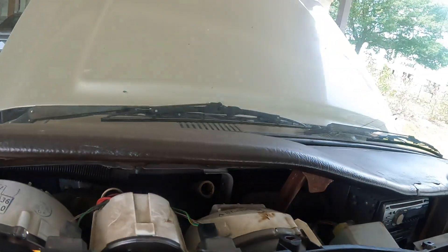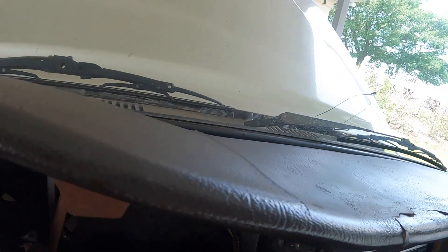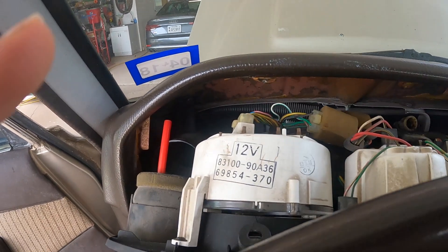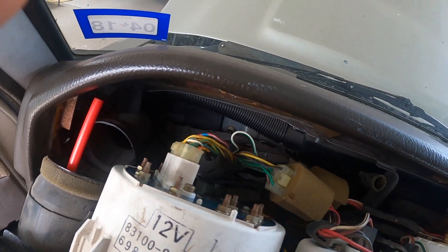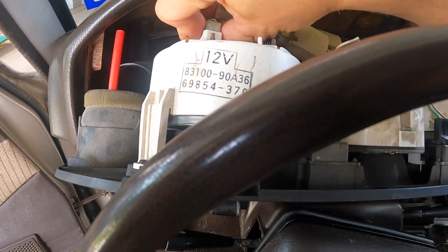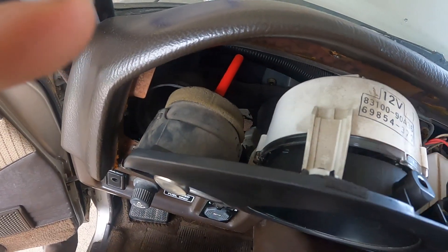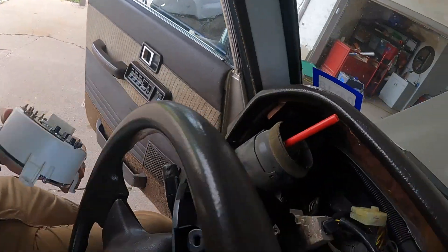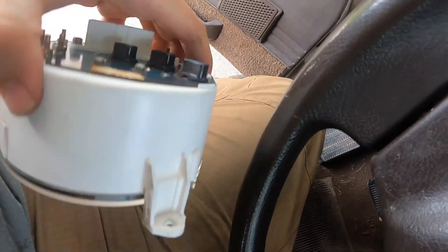It also helps to tilt the steering wheel as far down as it will go. Now you can rotate this forward and see what you're doing. The easiest way is to disconnect all the electrical connectors and pull the whole thing out onto your workbench. The alternate method is to just disconnect the combo gauge itself, unscrew it, and pull the gauge out to work on it. That's what we're going to do. We've removed our gauge — it's three Phillips head screws. Pinch the little connector, pull it out, and now your combo gauge is removed.